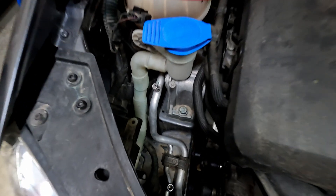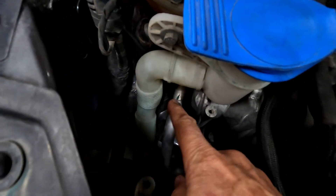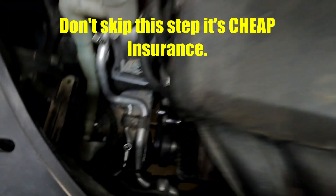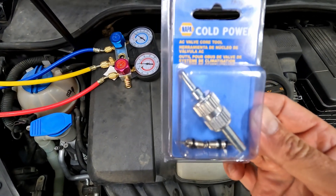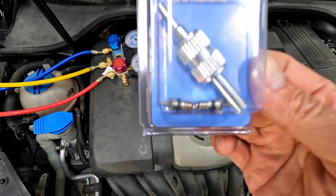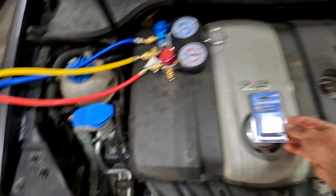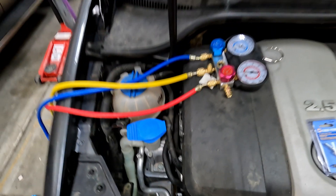Another piece of wisdom here: I've actually recharged this car once before. This time I'm going to replace this Schrader valve and this Schrader valve. These are European, so they're larger — they're big bore valves. We're going to see if these end up working in this tool. I tried my regular Schrader and realized those are much larger, so we're going to replace those valves.